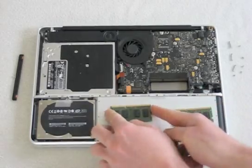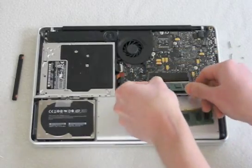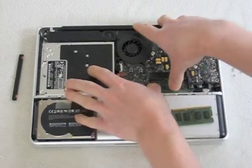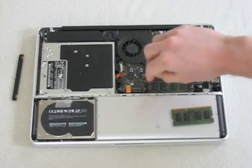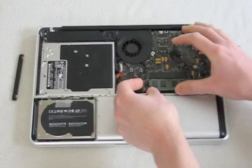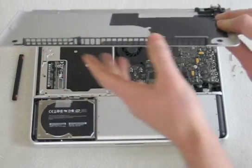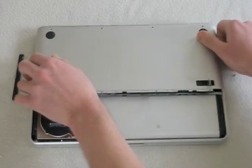When it comes time to replacing your RAM, simply take it, make sure that you have this little notch off to the left, then simply set it in. Be sure it's at about a 25-degree angle, be sure it's pushed in all the way, and then just push it down. You'll know it's mounted correctly by these little circular guides off to the side. Then set this next one in at about a 25-degree angle as well, and press it in. When you want to replace the cover, simply set it on, making sure this little black part goes into the notch back here.